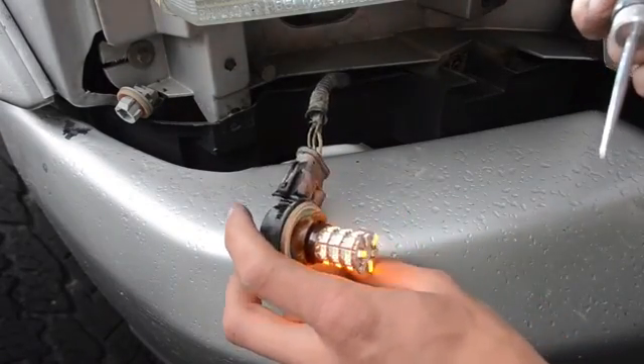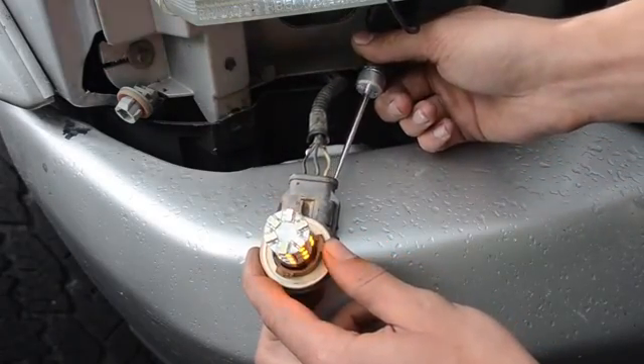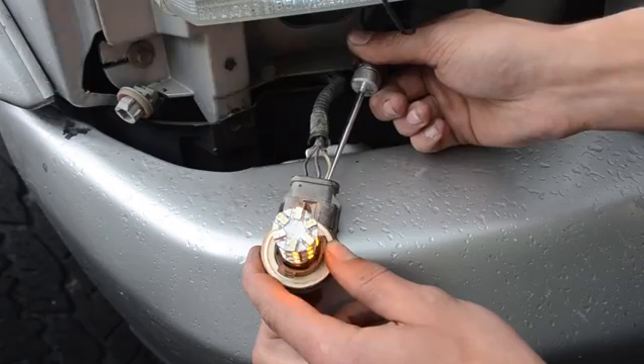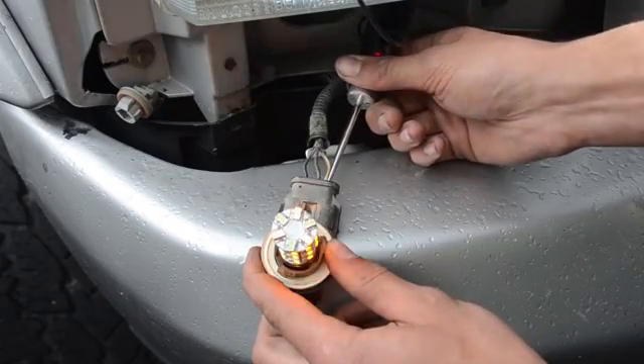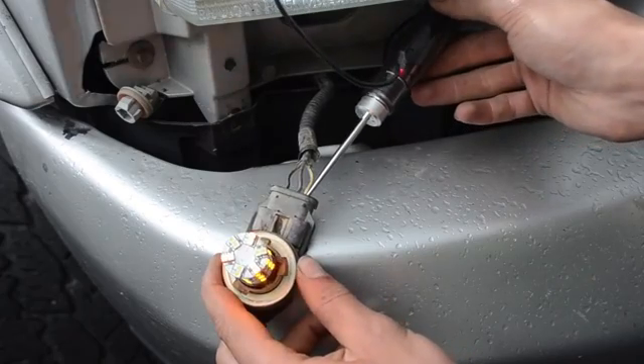As you can see we've got some hyper flashing. I'm going to stick the test light in here, and as you can see that's the right one because the test light is flashing — you can hear it. So that's the right wire. We need this yellow and green wire and this black one. We're going to bridge those two wires. We're going to leave this brown one totally alone, not even touch it.